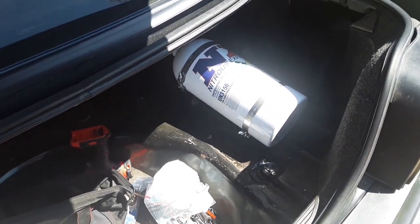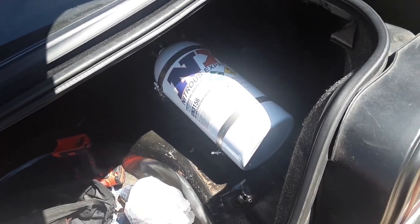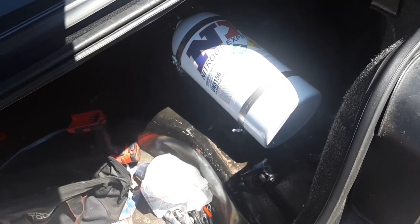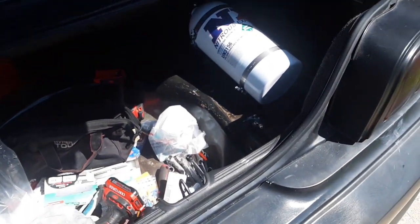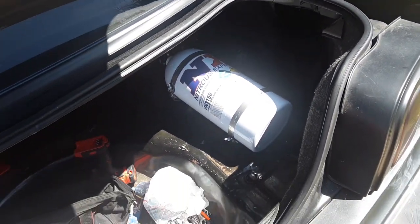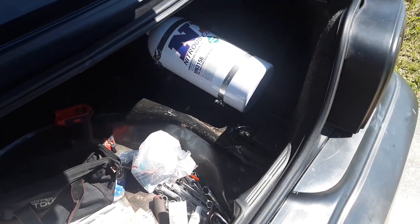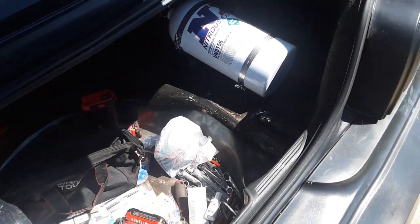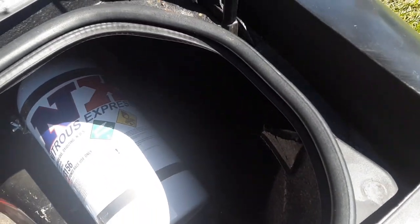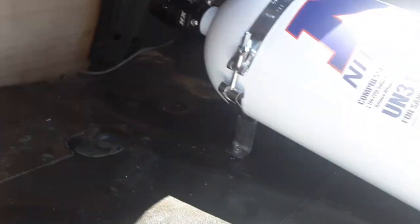Such as, right now, I'm running sheet metal screws, okay? Because it just goes through here, it's nowhere near the gas can, nothing moves to where it's going to touch anything, and I got them short to make sure. The other two are in the channel. I couldn't get a bolt on the back side of them over there. So I went and did some research, and per regulations and stipulations, you don't have to have bolts going through. You can have self-tapping screws. And this thing is not going anywhere if it flips over. It might, but that's all you're going to get, and you get that if it's bolted too. So I have set myself up for that nozzle. It's going to go straight down into that grommet, and we can start feeding it to the front.